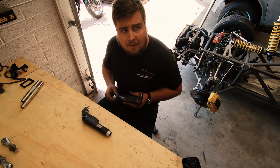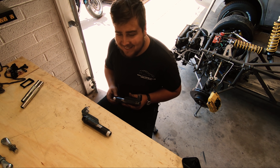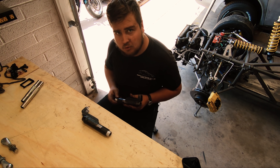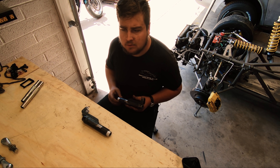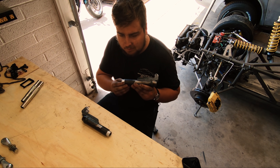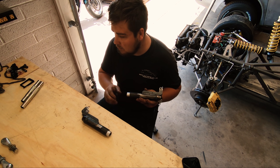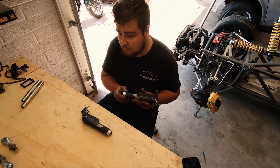Eventually the final design will be hydraulics for two reasons. Linear actuators aren't really as fast or strong as I'd like, they take up a lot of space, and that's a little bit of unsprung weight. I need as much weight over this front end as I can possibly get. So I'm going to go with a hydraulic system, which realistically may add about 15 pounds or a little bit less when it's all said and done. But for right now I want to prototype with linear actuators.